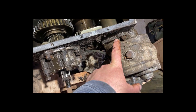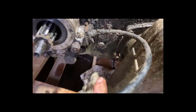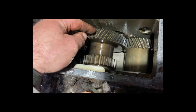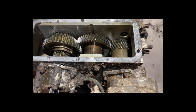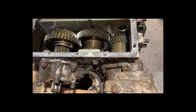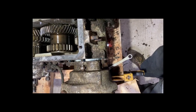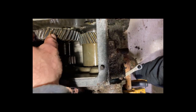Next thing off is the overdrive. Take that off then I can get to this shaft end here, take the tab off, knock the shaft out and then that comes out the intermediate. Once the intermediate's out I can get to that bolt, the nut and that one there — or at least I hope we can. So once we've got this section off I can actually have a look at the gearbox. Just pulling off the overdrive, you can see how as it pulls it's got to rotate a little bit, which it's doing.